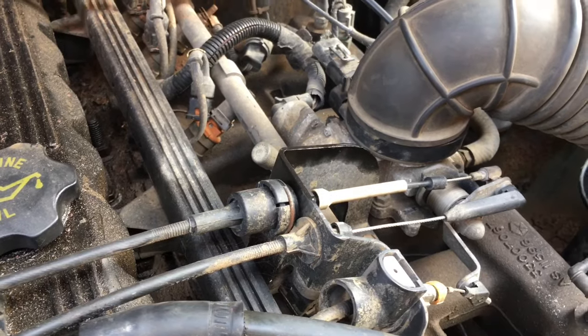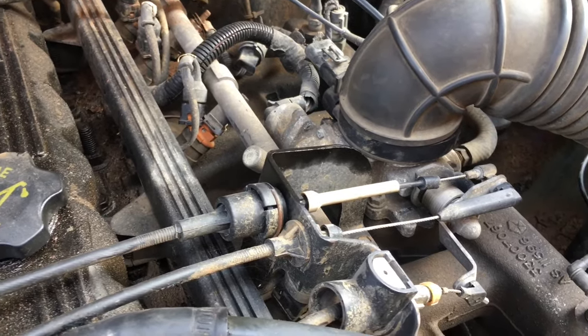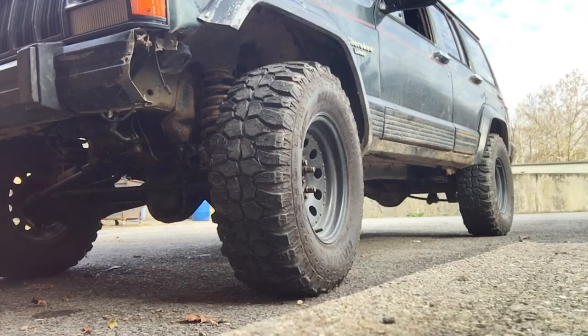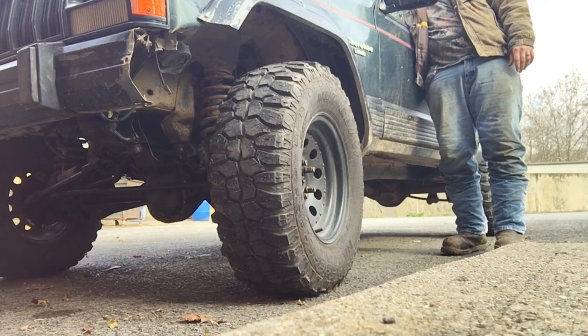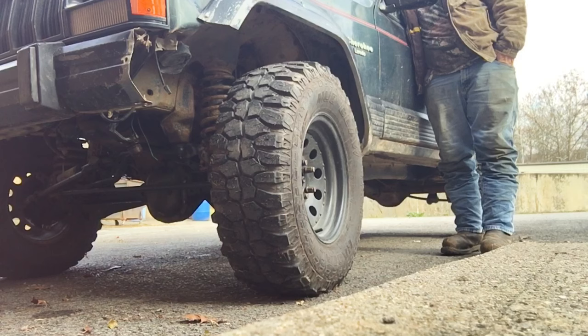I'm not going to worry about mine — I'll just prime it up on key starts and wait till the fuel pump actually goes bad, because I'm not going to pull the tank just to put in a fuel pump when it's not really bad, it's just a valve. Just to prove that my key cycle thing works, I'm going to start it. It's been sitting for 20 minutes. I'll let it sit again, cycle through the keys to let the fuel pump prime, and then start it.